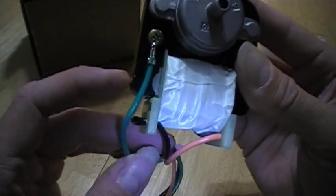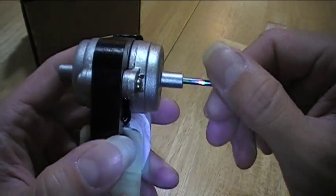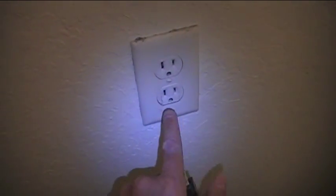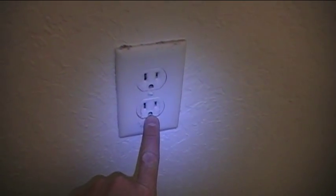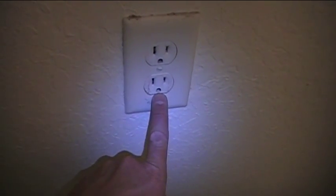Let's take a look at the back of the motor — you can see the green wire, and I'm pretty certain that's the ground wire because it's connected to the main metal body of the motor. The replacement motor spins freely, so let's go ahead and get the old motor out of the refrigerator. As a safety measure, in addition to taking everything off the top, we also want to unplug the refrigerator from the AC outlet in the wall. The middle connection is where the ground wire ultimately connects to, and that goes through the wiring of the house to a rod that goes into the soil, providing a connection to earth — a margin of safety to prevent people from being shocked.